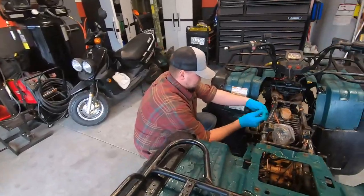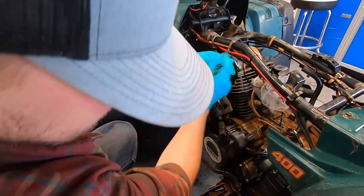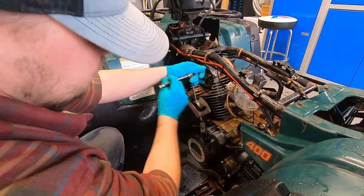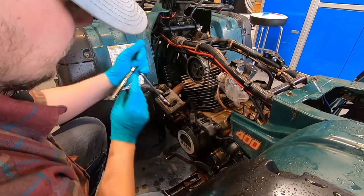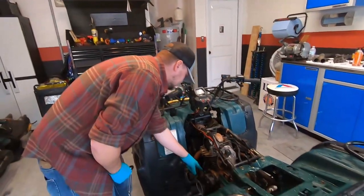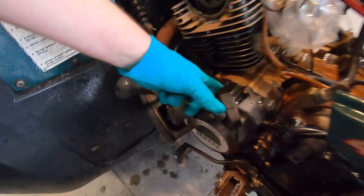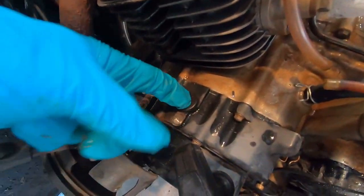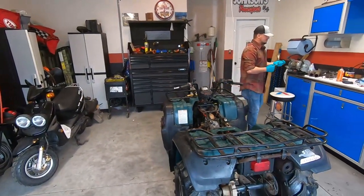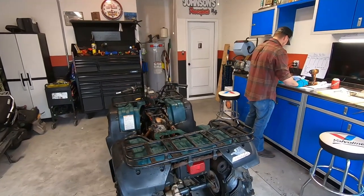All right. Yamaha conveniently placed this shifter right here in the way, so it's about to come off so I can make sure we're TDC on the crankshaft. Look at that. Beautiful. Right out the way. So I need to get in here. This is your inspection window. Flathead takes that plug out, and we'll be able to see the flywheel. Gotcha.